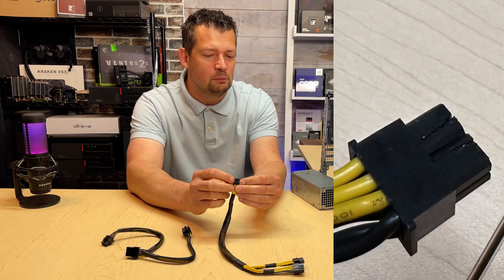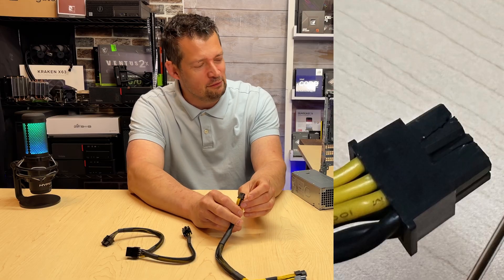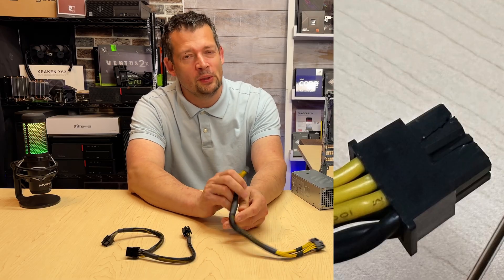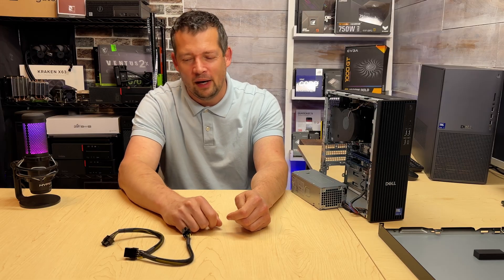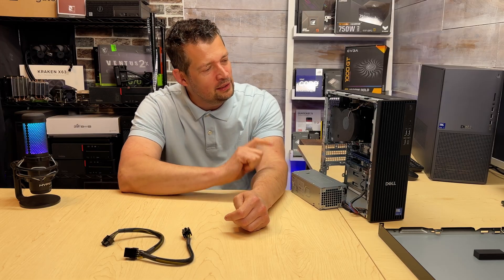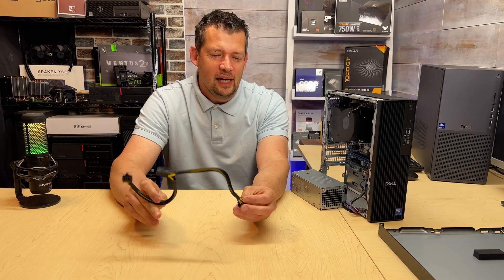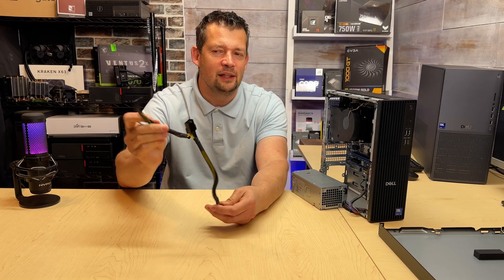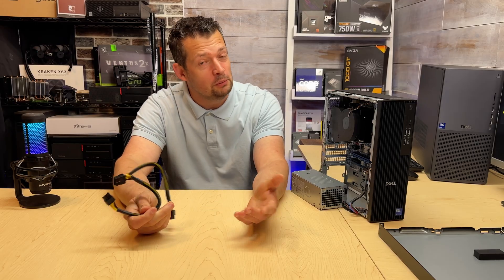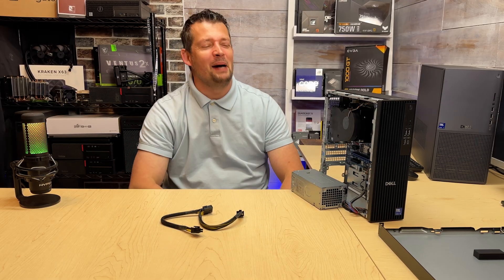I really had high hopes that all I'd have to do is plug it in, slam a card in, and connect an 8-pin or 6-pin. It's not happening because the back side has only two sections when it should be four. I tried to do it with a knife, but I'm afraid to plug it in and create a short. Don't even try. I'm gonna wait for the cable — it should be here in two days. It has a female connector, connects to the male, and feeds back to this 8-pin, and then we should be good to go for a third-party graphics card from the 360-watt power supply.